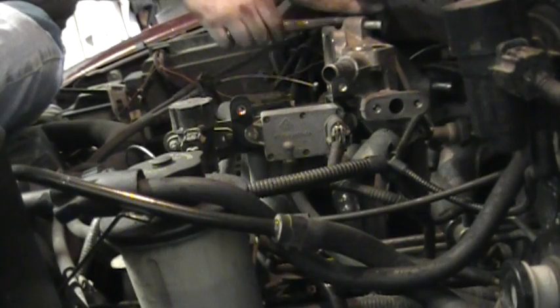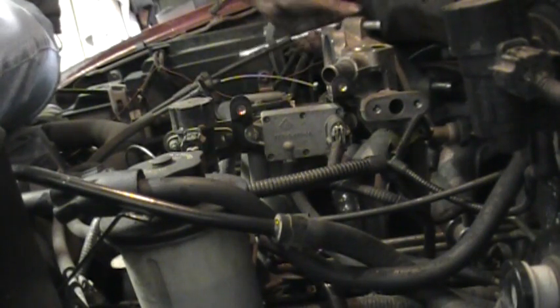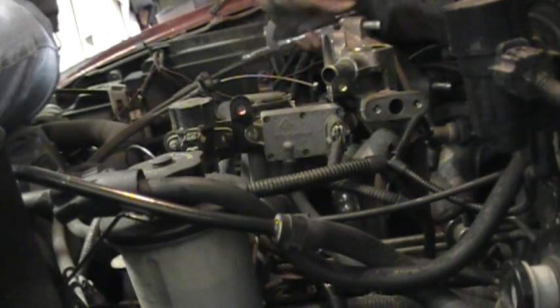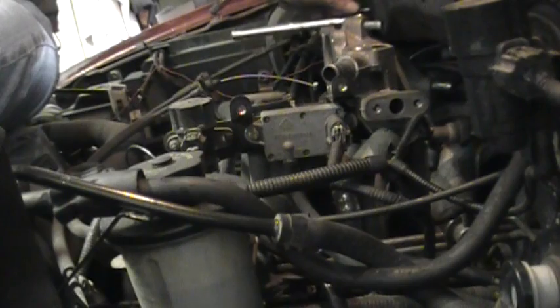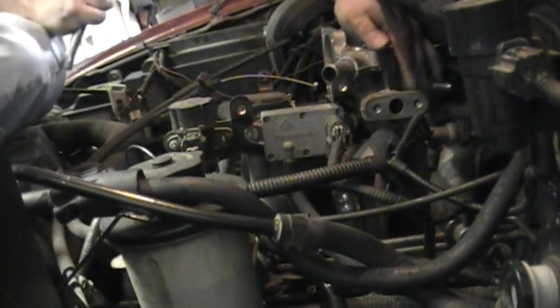I wonder if it's worth changing that fuel pressure regulator diaphragm. It would be easy to get it right now. Well, the thing is, because of the ethanol fuels, the ethanol tends to chew through it, but until you notice bad gas mileage, kind of rough running.